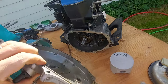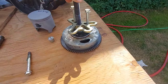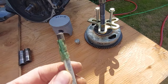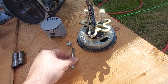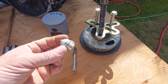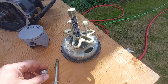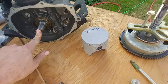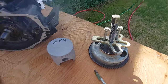On the outside of the flywheel there is a harmonic balancer tool if you need to remove the flywheel from a 650. I like to put tape on the threads and don't run the threads in more than 10 millimeters or you're going to hit the stator wires and damage them. When using a harmonic balancer puller, make sure you don't use just the outer part — that just pushes against the flywheel while you're trying to pull it, which won't work. You need the center threaded bolt to push against the crankshaft and the outer bolts to pull against the flywheel.